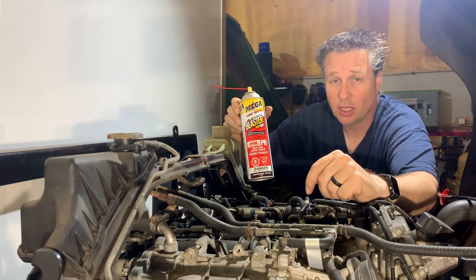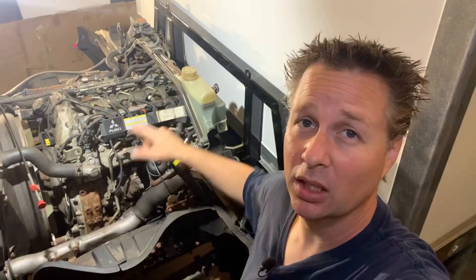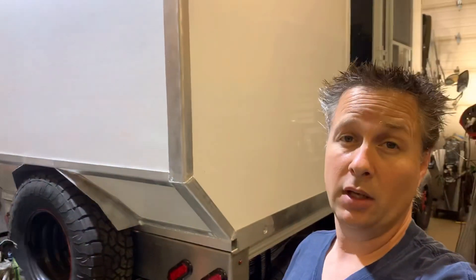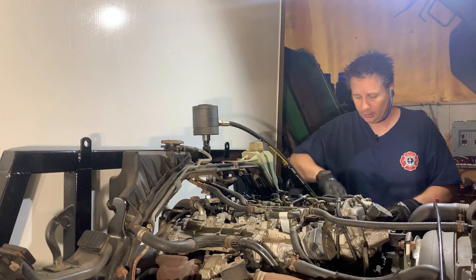One of the unfortunate downsides of the adapter that I'm making is that I don't really have a whole lot of room for weld. The nut is actually fairly large and it comes very close to the edge of the plastic part of the injector. So when I put a weld on it, I have to grind most of it back off again. But a full perimeter weld around the nut ground back down is going to be much stronger than two small tacks. It's also worth noting that for the past week I've been dousing the base of this injector with PB Blaster. The PB Blaster has been soaking down around the injector, but that also means any water that's got in there for the last 11 or so years has also been able to go down there. The injectors are steel and this is aluminum, and that means they're going to react and corrode down inside there, which really is the cause of having to go through this entire process.